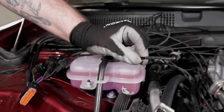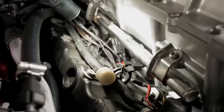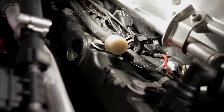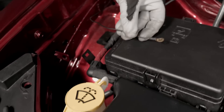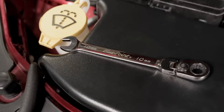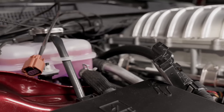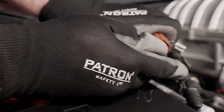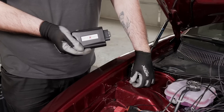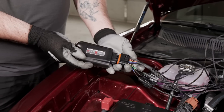Now that we have connected the wiring harness on both sides, we will place the temperature sensor nearby the engine block — it's the wire with the orange tip. Once the temperature sensor has been placed, we will now install the ground wire. It's important to mount it on bare metal. Use a 10mm wrench or socket to remove the bolt. On these Hellcats, there's a specific mounting point for the ground wire. The brown plug on the harness connects directly to the ethanol sensor — listen for the click. This is the control unit; it has Bluetooth connectivity. We will now connect it to our wiring harness and start the car to test if everything is operating correctly before we finalize the installation.